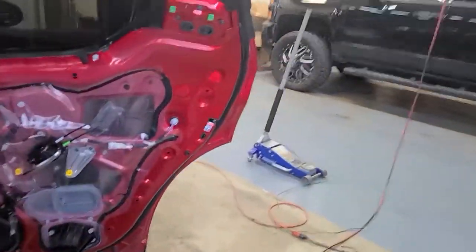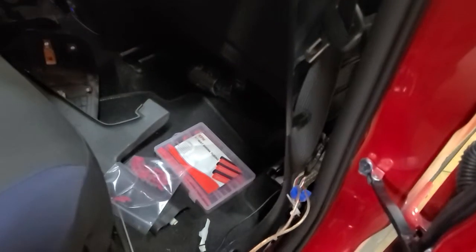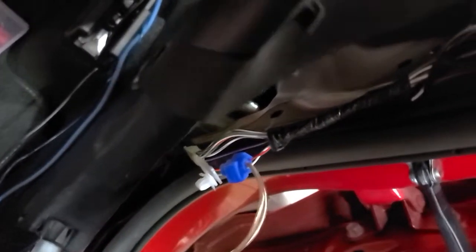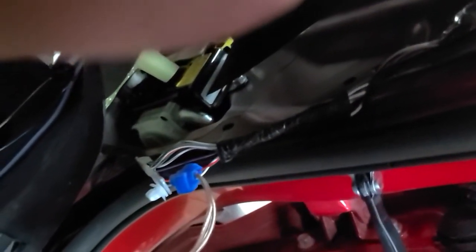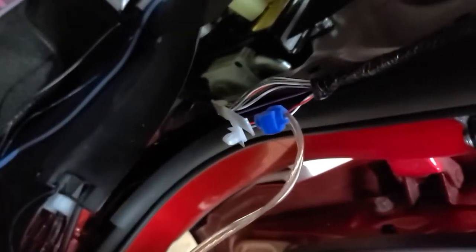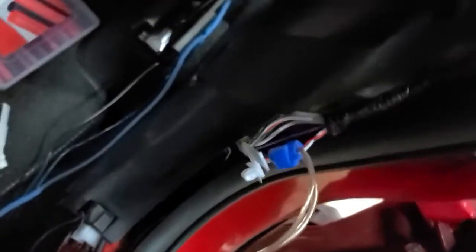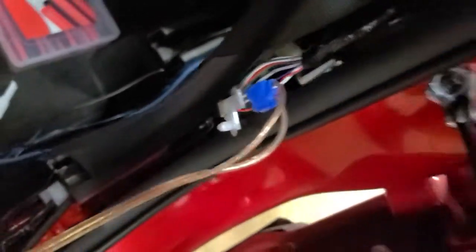I ran the speaker wires, the power wires, and the remote on. The speaker wires were a little difficult to tap into — that harness doesn't give you any indication what is what. There's a red and a white wire, and I finally found out you look for the twisted wires and tap into those. Those connectors aren't great; I was trying to use better connectors but that was all I had, so we're going to redo it a little later when I get some better stuff.